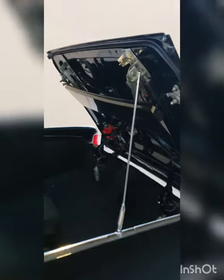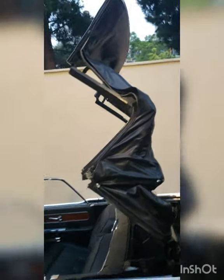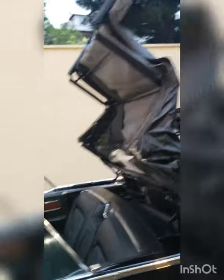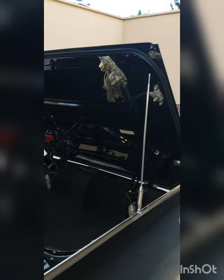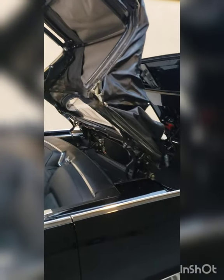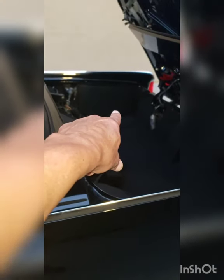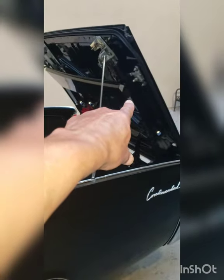Here's the second part with the flappy back panel closed down — this is the second step in which it goes. Then when the trunk top comes up, it lands on these windshield header locks, and when that locks in right there, the top closes down and sucks it down. With the windshield firmly locked down into the windshield header, that sends all the power to the pump in the back and operates two solenoids that bring the top all the way down.